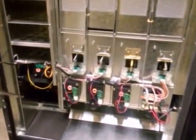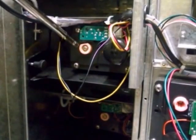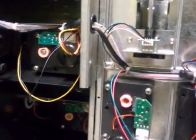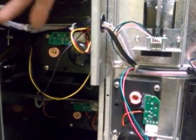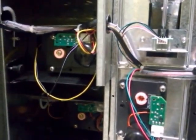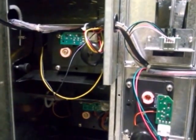On the number 1 and 2 selections, you'll see there's only 1 notch on the pink stub. That indicates that it's going to interrupt the cycle. The sensor here, the kill switch, is going to interrupt the cycle only once in the 360-degree revolution. There's a rocker in here that kind of rocks back and forth, and it takes a full 360-degree revolution to get it to come out. It's the same thing with the snacks on top. The coil needs to turn 360 degrees.